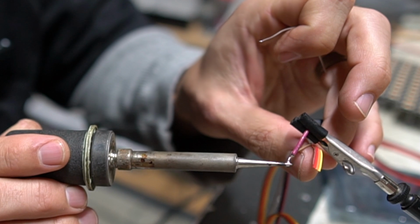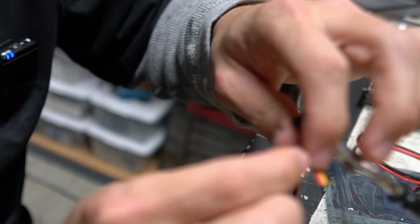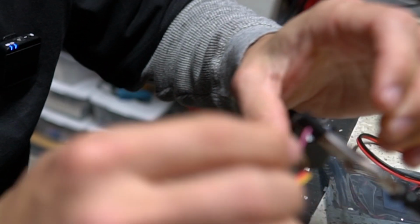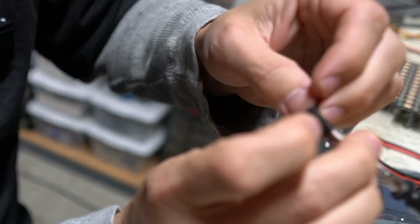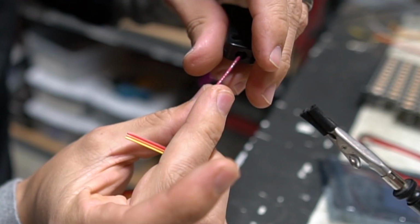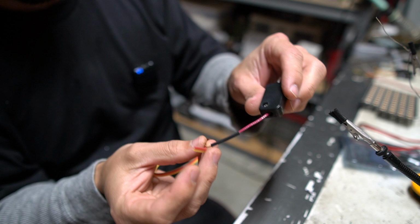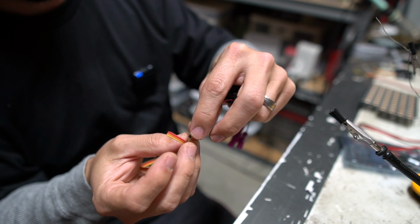And that's one of the things with wire too, is once you start messing with it, now look at that big kind of bulky chunk that we have right there. And maybe if we cut that off, we'll be fine. But hopefully we don't end up losing the structural integrity of that little solder bond. And there we go. So it's not ideal, it's not awesome, but that method can work better on thinner wires. Definitely not 18 gauge or 16 gauge. That's definitely too thick to do it that way.